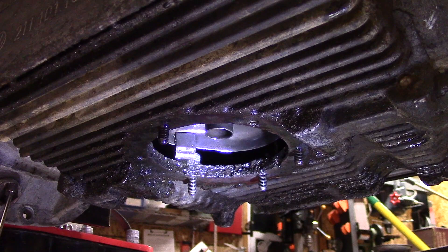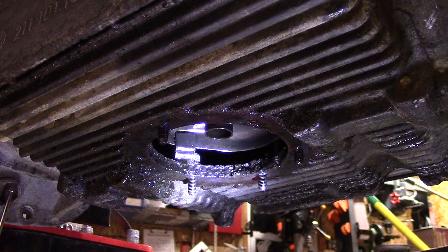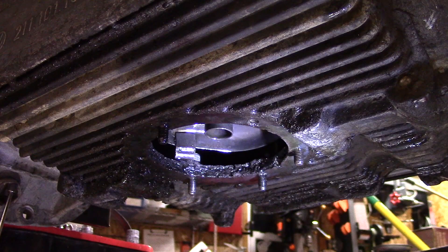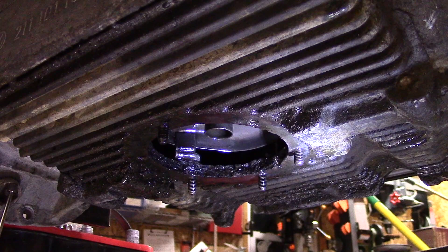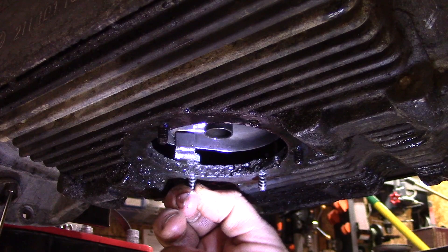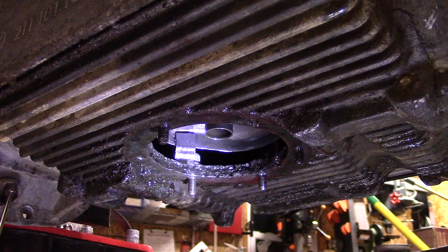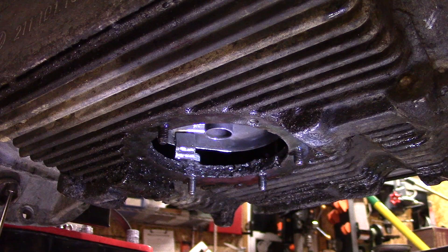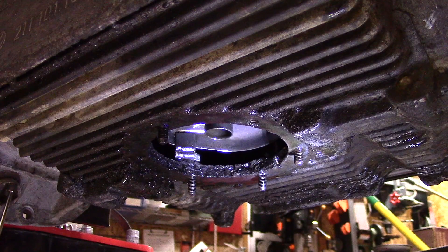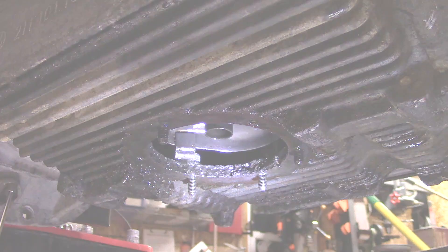As I put the cap nut on and press the plate, that will only further pull everything secure. The lock nut is not going to wiggle off in the back, and the pickup tube is totally secure — no fear of it coming loose. This job is done as far as fixing the missing lock nut on the pickup tube. For any other studs that pulled out, just power wire-brush them, double-nut them, break them free, and put the studs back in. If this is a brand new case you could use Loctite, but these old cases are so oil-impregnated that Loctite won't work. Keep your studs clean and put a little Never-Seez on the cap nuts so you can get the sump plate off again next time without pulling studs. Hopefully this helped — let me know in the comments, subscribe, and share these videos with other Volkswagen folks to keep these things on the road.